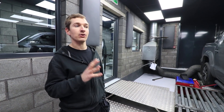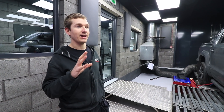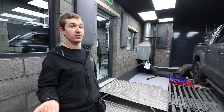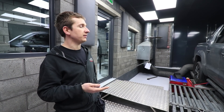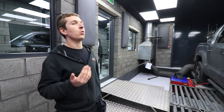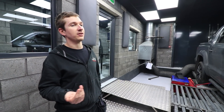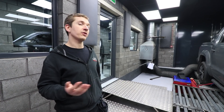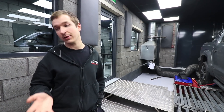So what I decided to do - obviously it wasn't going to help us - the next step was going to be doing 0-60 runs with the gearbox before and after, put it back to standard, run it, then put the gearbox tune on. But that was pointless because the DPF was blocked. What I thought was a good idea was to put it back on the dyno while the DPF was blocked and see what difference that actually made.